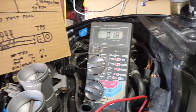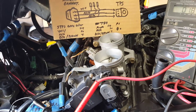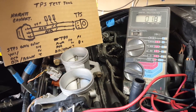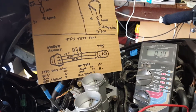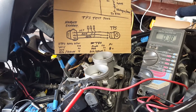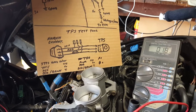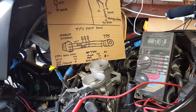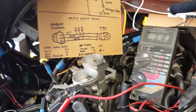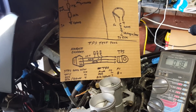I hope that helped. This test can be performed on both the throttle position sensor and the secondary throttle position sensor when testing for proper ohms. There's also a voltage test you can do. I've already tested this about four or five times and had a few skips somewhere in the range of 3.2 to 3.7 or 3.8. So I went ahead and purchased a new throttle position sensor off eBay for $35. I'm going to slap that on and see if it fixes the problem. Hit like, don't forget to subscribe, and I'll see you next time.